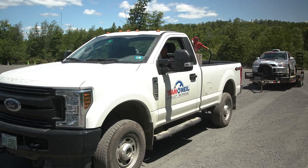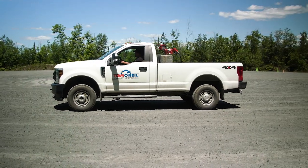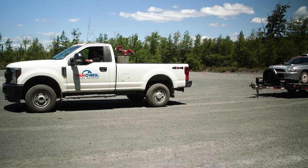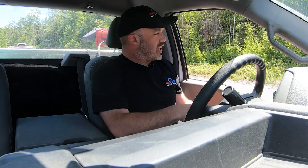There are so many vehicles where that back window just isn't an option because of luggage or the vehicle type. So I keep my head centered and have my mirrors lined up to see my whole trailer, from down to the tires to the top of my ramps. I look to see that I have even spacing on either side of the trailer, start rolling back with tiny little adjustments to get straightened up, and then get to a point where I think I'm close enough and stop.